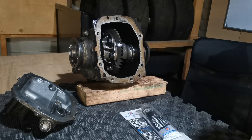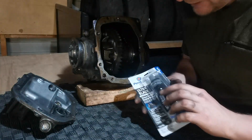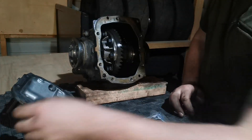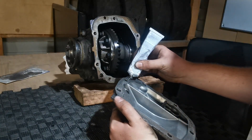The diff is all welded up, finished, and locked. What we're going to do now is seal the rear housing onto the back of the diff. We're going to use some sealant, go around here, and then chuck this back on. Just going to do a thin bead.